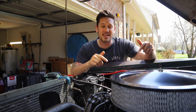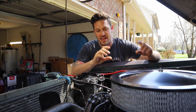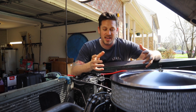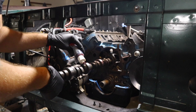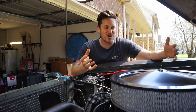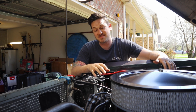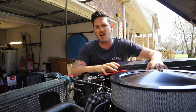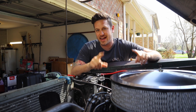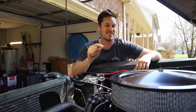That's why I think I'm having trouble — I'm having some header exhaust leaks and I'm wondering if that is part of my problem on why my Fitech is running so rich. My Fitech handheld controller isn't working, so I'm kind of just going off feel and sense here. But the other thing I can totally tell is that I have some exhaust leaks going on. You can hear it when the engine's running, so I'm going to take the header gaskets off and take a look at them to see if we can figure out if we've been having some leaking issues.